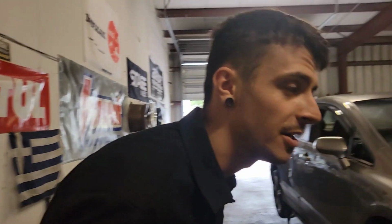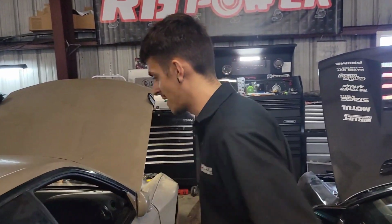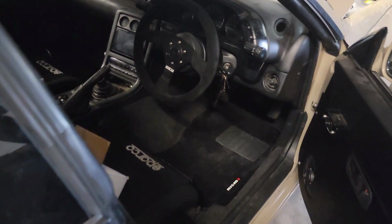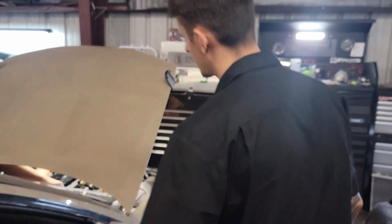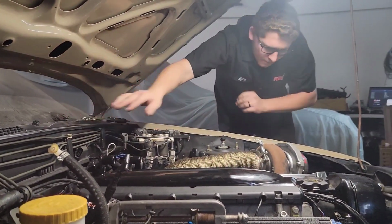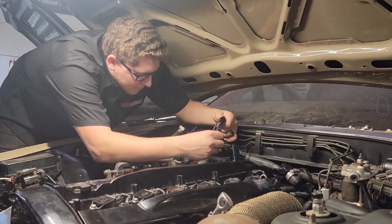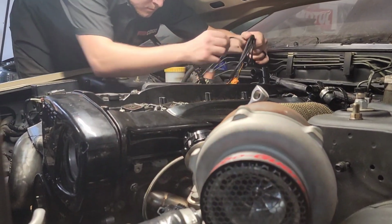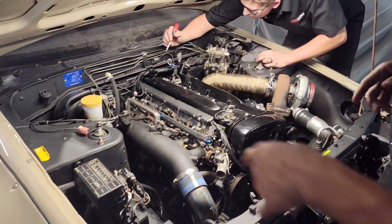And then we're gonna walk over here and see what's up with Kyle, as you can see, now Mike's interior is put back together. Everything's wired up. Wait, what ECU did you get, Kyle? Haltech Elite 2500. Kyle's putting in the R35 coil pack kit. After that, I'm going to help him button the rest of the stuff up on the car. So starter, alternator, and then from there, we have to connect 2 fuel lines, one from the regulator, one to the return. And then realistically, we can at least hear this thing crank or try to start.